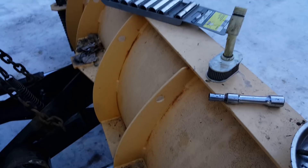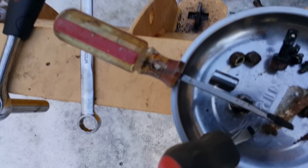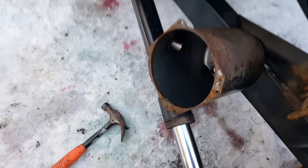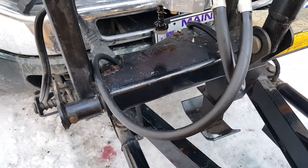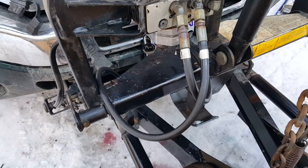It's just held on by an o-ring and sticks in pretty tight. I've got a 2006 GMC and I'm surprised it held as long as it did with all the bumping and banging. The way you take it off: there are simply four small screws — you can see them there in the tray — and they are right at the top of the canister, as you can see the holes there. They're fairly easy to get at, but they didn't leave enough room, so when you take the canister off it won't clear. You have to take two bolts out — one in the front and one in the rear — and you just slide the whole thing over to the side and the canister pops right off.